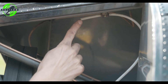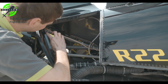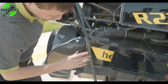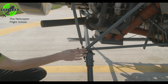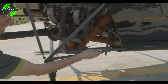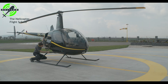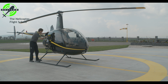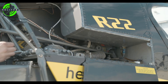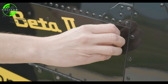Static source — clear. Steel tube frame — no cracks, all fasteners secure. Control rod ends — free without looseness, check for no interference on tail rotor control. Cowl doors — latched.